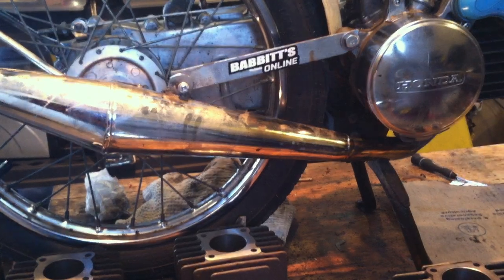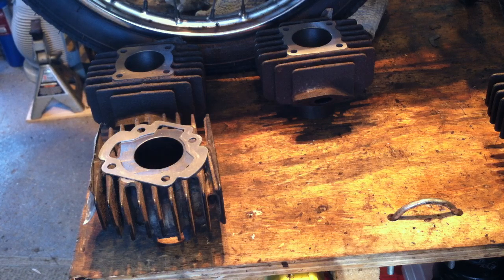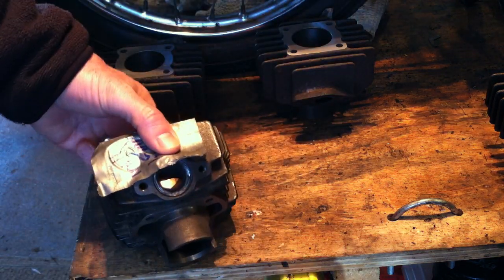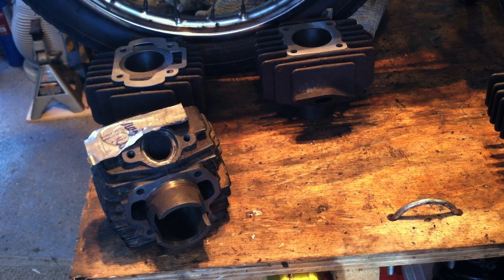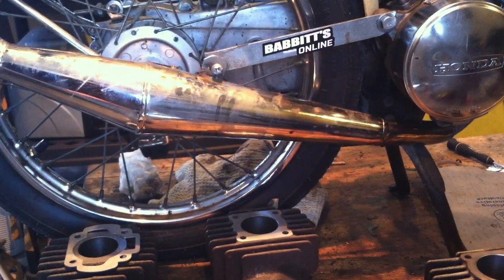The Honda cylinder is going on the Urban Express hybrid bike I have. The other thing I did to this cylinder — and the one on the Spaderator bike — is I opened up the exhaust port. I may have already raised it slightly, maybe a millimeter, so in effect the exhaust port is being pushed up about two and a half millimeters total. You want to be careful with how much you raise it, because the farther you effectively raise the port, the higher the RPMs required for the pipe to hit.